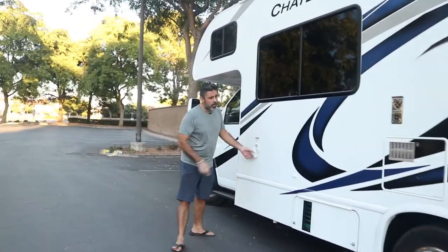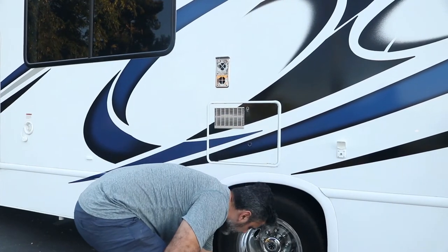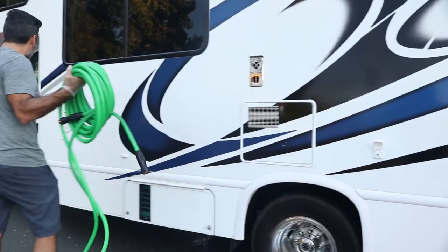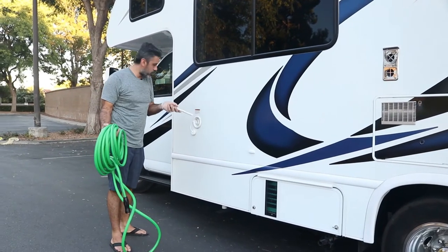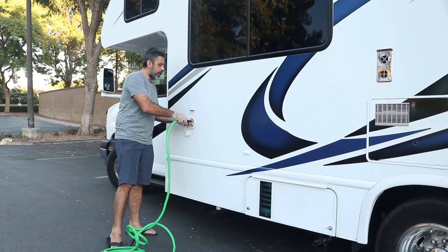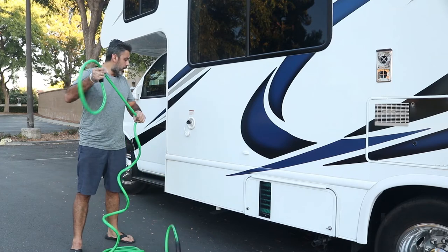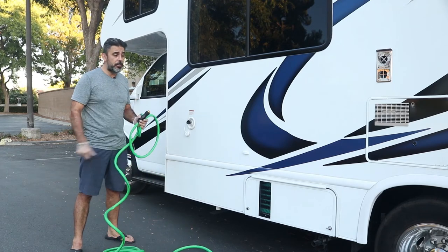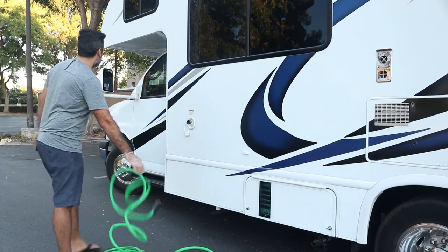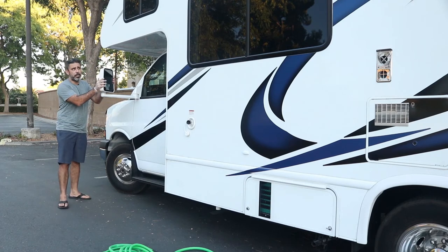This connection provides for our fresh water tank. You'll be using the green hose — remember, this is for drinking water. Put it right inside all the way and connect it. This allows you to have water while on the road, or at a campsite that does not provide direct city water connection. For the side view mirrors on this side, they are also manual — just move them manually and they'll be set to go.